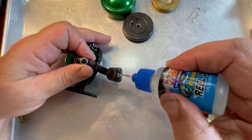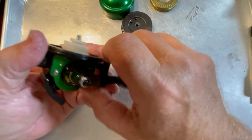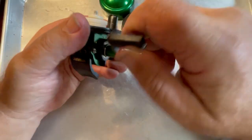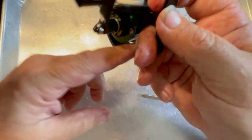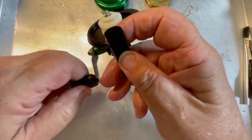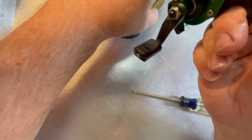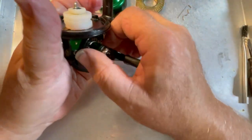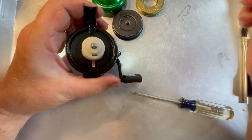Take this side plate — this shaft right here has to go through the hole in the button, and you may have to flip it over so you can see it go through. Once that's done and you've got it in, put it back in like that. If it's fitting properly, everything should line back up. There's a slot right here — make sure that slot goes into that slot when you hook it in, otherwise it's going to stand proud and won't go in. Put these screws in and snug them up nicely. Now you should be able to slide on your handle and tighten the nut down.